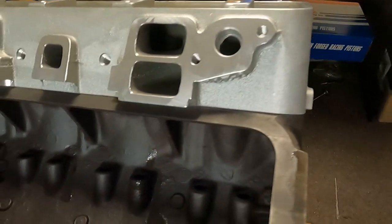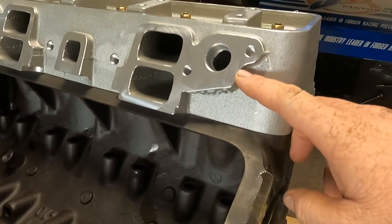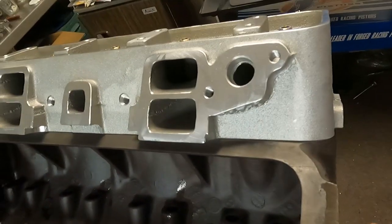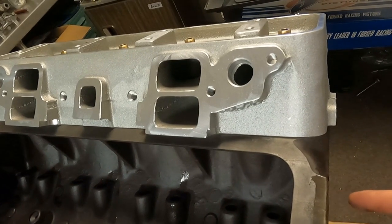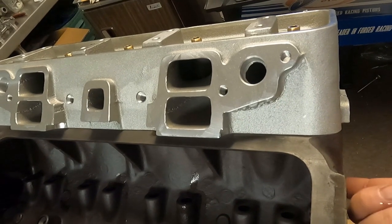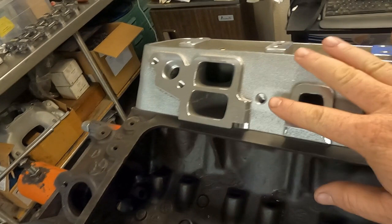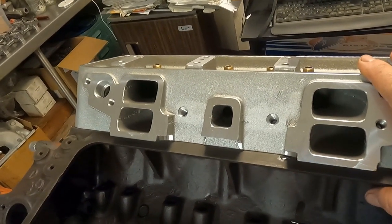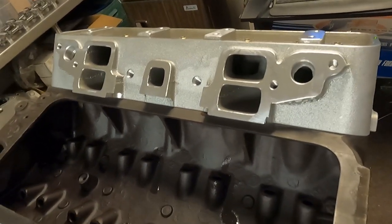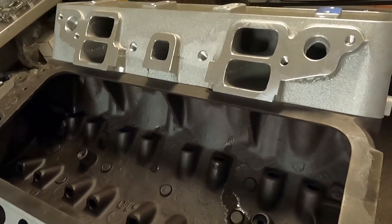The first thing you want to see is that with the cooling hole in the head and the cooling hole in the block being very close, you might understand that you could have a short circuit bypass here — where the water could come in and leave, leaving a whole bunch of the water down here stagnant or not moving, and that would cause the engine to overheat.